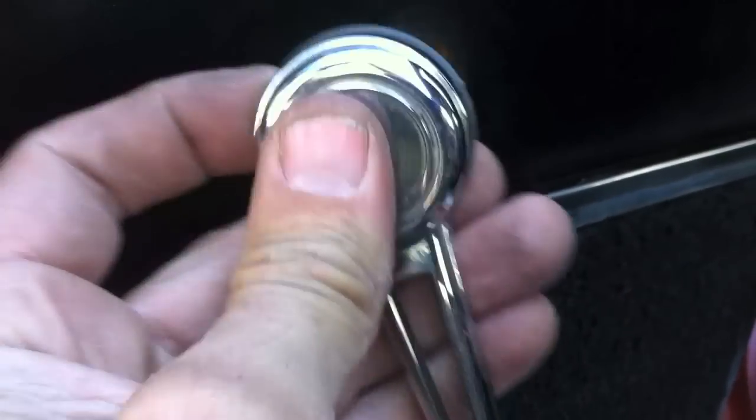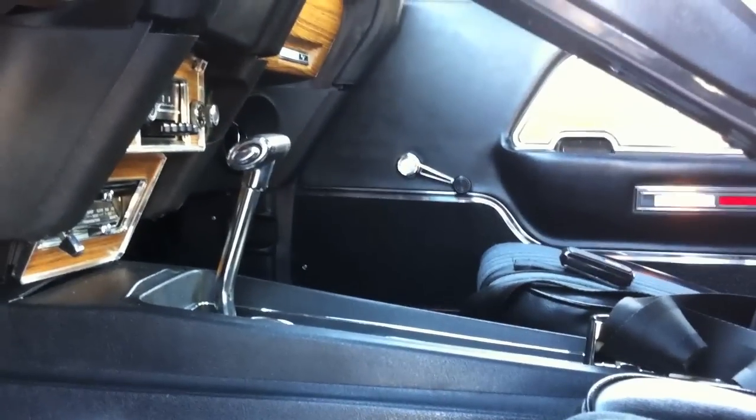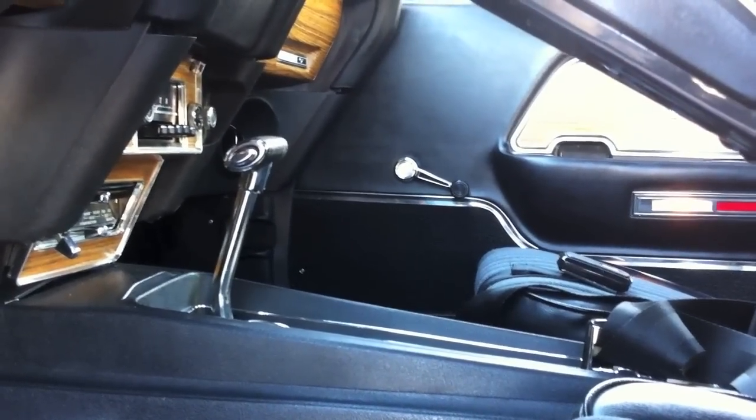All screws are now attached in the bottom of the Grande door panel. Now we are going to move to the light fascia and putting back on the window crank. Don't forget the little plastic piece you've got to put in between so it's not rubbing directly against the vinyl. Put that plastic piece in before you put the crank on. I always try to line up the cranks — see that back angle? Look how beautiful that interior is.